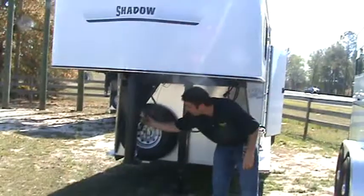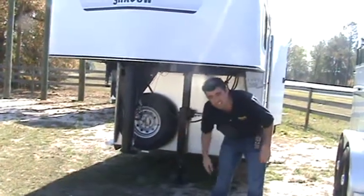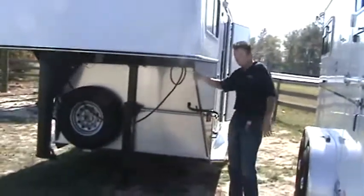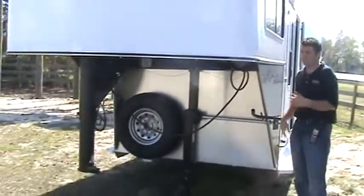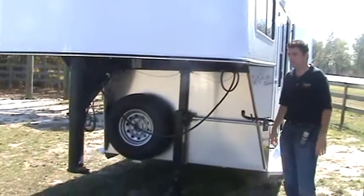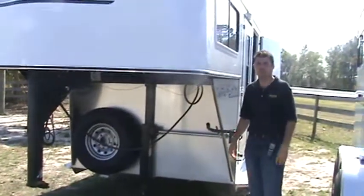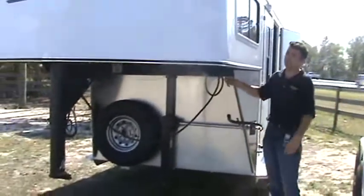You have cables instead of chains that get out of the way a little bit faster. They don't get in your way and they're not as heavy, but still very strong. It also has a self-locking hitch, so you don't have to crawl up on the bed or deal with a pin going through the plates — avoiding the risk of bending the pin and having to get it replaced, which costs about $500 to $1,000. It's very easy and very quick; you don't have to get up on the truck.